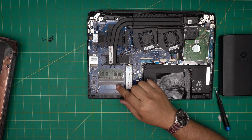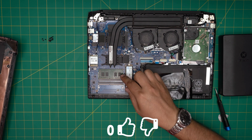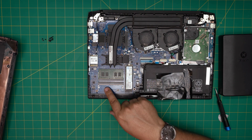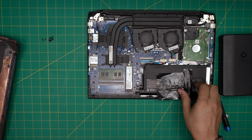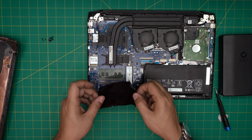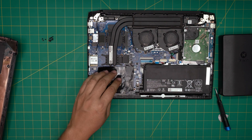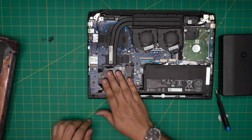This is very important: once you have both RAMs installed and you power on, if after 5–10 seconds you don't get anything on the screen, power off and put just the new RAM in first, then power on. Once you get the HP logo, power off quickly and place the old RAM in the second DIMM slot, then power on again and wait 5–10 seconds — it will work. This has to do with the BIOS and motherboard not recognizing new RAM, so switching the order can fix it.